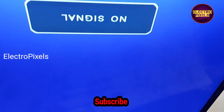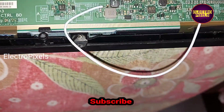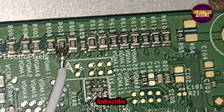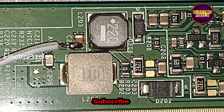There is no more double image and picture freezing issue — the panel and TV are repaired successfully. In case after bypassing with the LC1 test point the picture is not correct, then instead of LC1, try bypassing with the LC2 test point. If both sides of the panel are shorted, then it is not repairable.